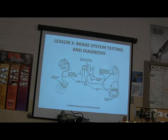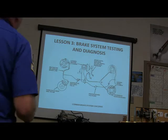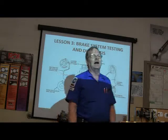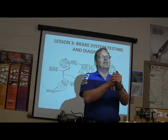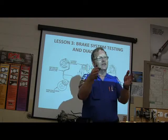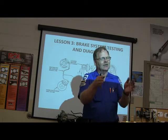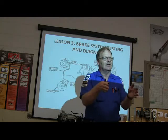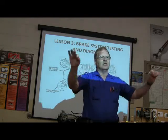Strange thing. All right, so you can have other brake problems like a restricted or leaking brake line. How's that going to play out? What happens here is I'm hitting the brake. The truck starts to pull when I hit the brake, and then it sort of straightens out. It stops straight. You got me? It starts to pull, and then it stops straight. What that is, you got brake hoses going out there.